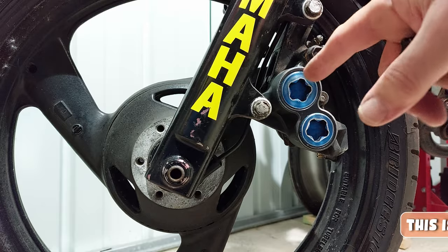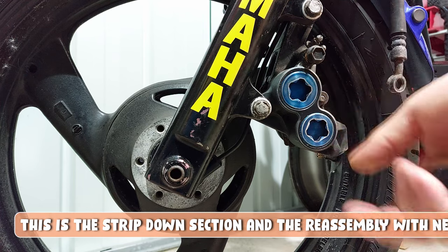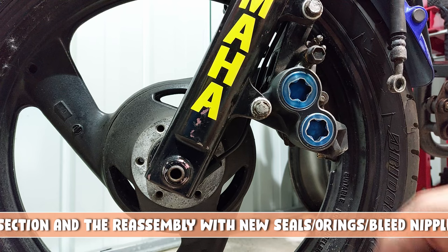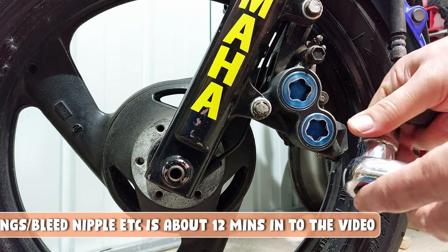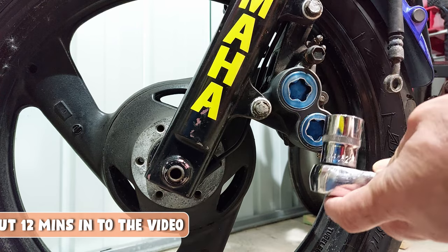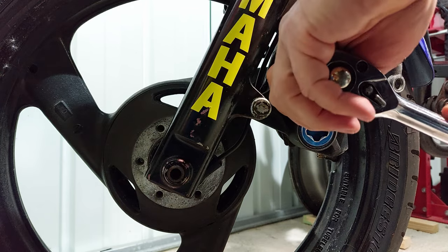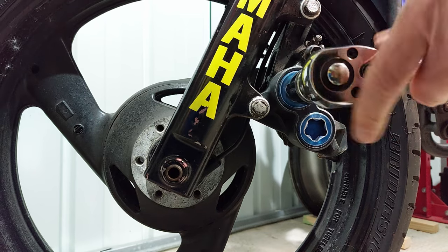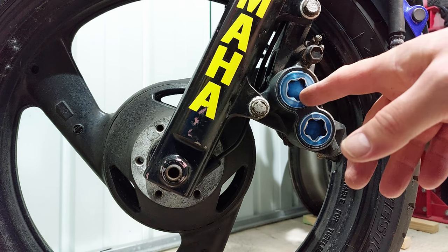I've put the caliper back on the bike because that's the best way to hold it. You'd have to take the caliper off first and get the oil out, because if you undo these there's going to be spillage. You pop the tool in there and use a 22 millimeter socket that goes in the end there, or a spanner. Give it a try and there we go - it turns as easy as that. It shouldn't be too tight, and if it is, somebody has been there before and done it up too tight.